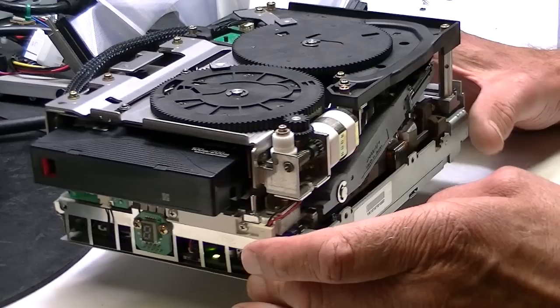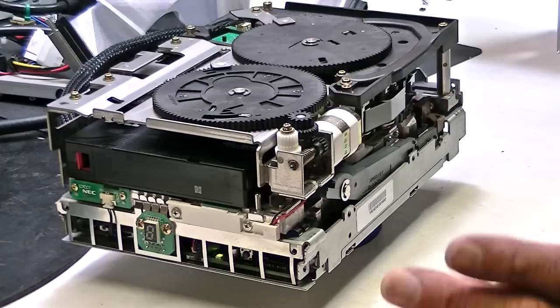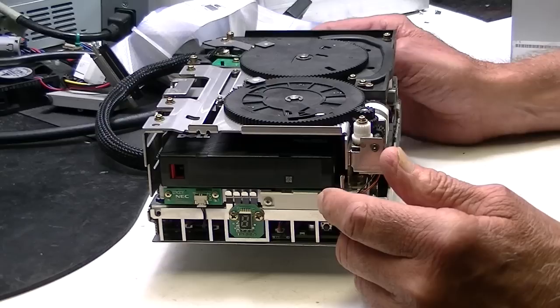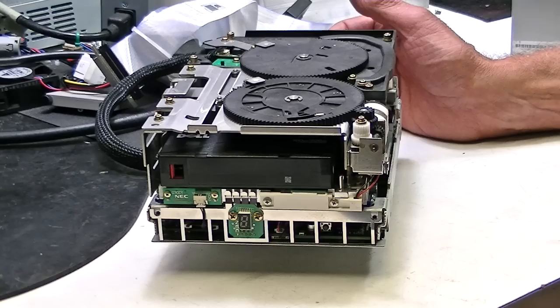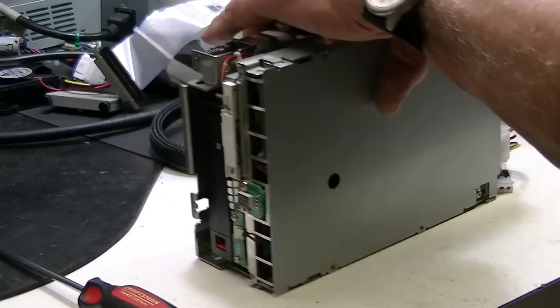So what I'm going to do is simulate how to do this manually. I'm going to load the tape one more time, and once it gets loaded and everything is ready for data, I'm going to turn the power off. You have no power on this drive — you can't get the tape out. If you could power this up on the bench, you might want to hold the reset button or the eject button down for 15 seconds, then let it out. Possibly it will reset the board and the tape might come out. But probably not. So now we have no power on this tape drive.